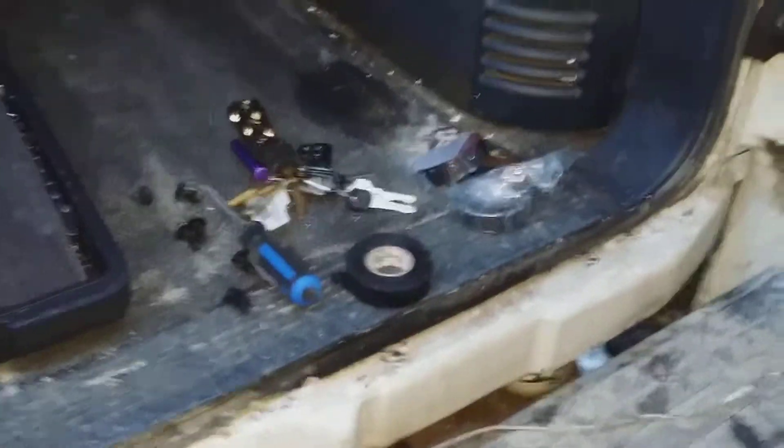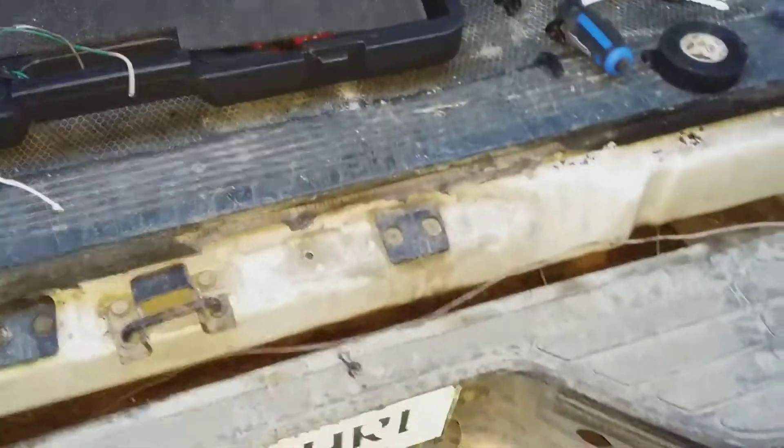Alright guys, I'm back. What I did is I cut off all the wires that were spliced off the main and re-taped them up good and solid with electrical tape, then put them back where they go. I'm gonna have Jacob come over and check if I'm actually getting a reverse light now, because there's a lot of garbage going on down here — stuff I don't even know what to do with.